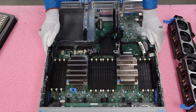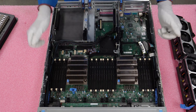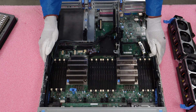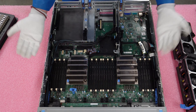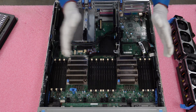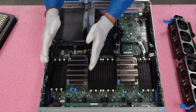So let's say you were not fully maxing out your system — you're going to put in 8 DIMM slots or 16 DIMM slots, not a full 24. How do you know which DIMMs to put them into? Everything comes down to the channels and you want to maximize your overall performance. You want to have a nice balance across all your channels. On each CPU there are 12 DIMM slots for 24 slots total, and there are six memory channels per CPU.